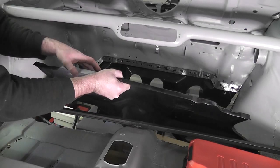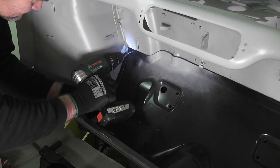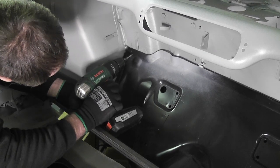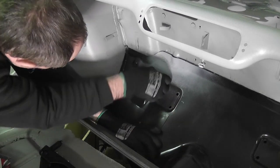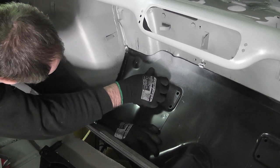I came up with a plan just to pin the board in place to line it up and then to weld it on. It was difficult because the rolling jig can't be used when the subframe is fitted and I can't weld while the subframe is on, so I'm having to pin the board on, remove the subframe, reattach the jig and get the car outside to weld it, as I can't weld in my woodwork shop for obvious reasons.